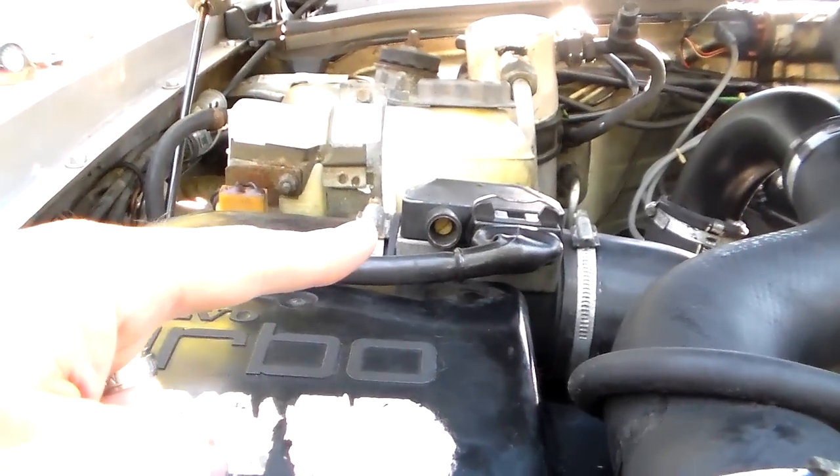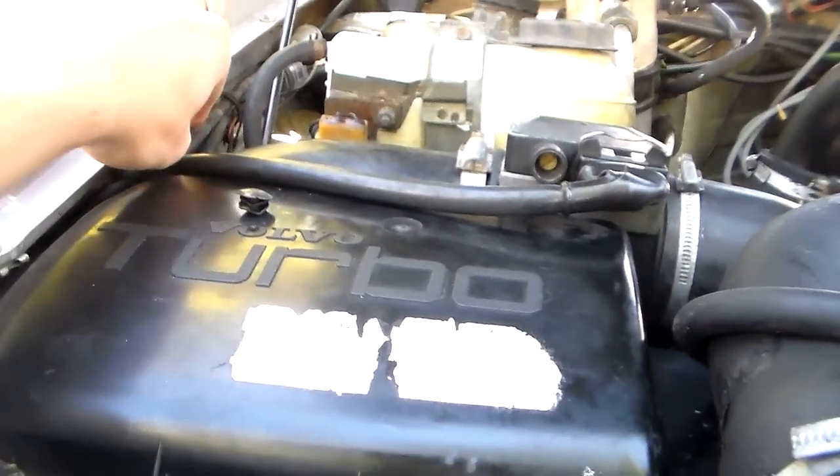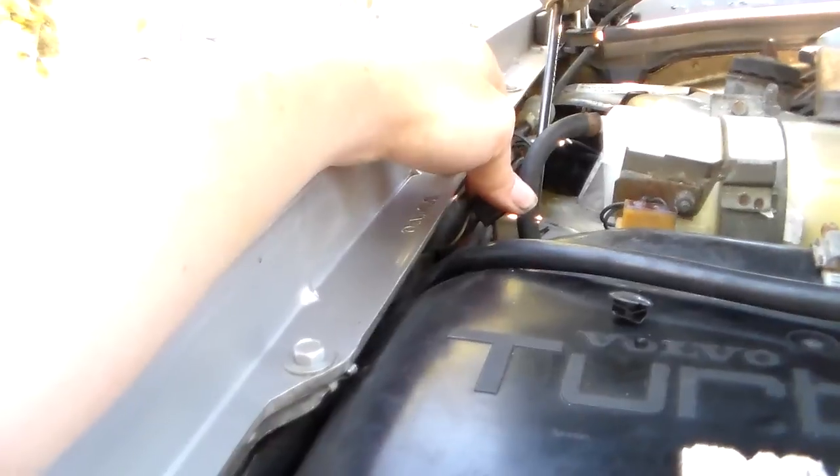So what you do is in conjunction with the test port on this car, a test point. If you look back in your harness on the right side, the passenger side, you're going to find, tucked back in there, a plug that's got 2 wires in it. You've got one red one with a black tracer, it may be red with a white tracer, and then one that I believe is green and white. The red one, that's what you use. You ground that out to set your base idle.